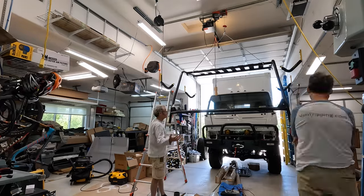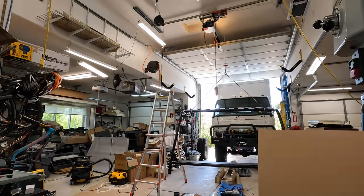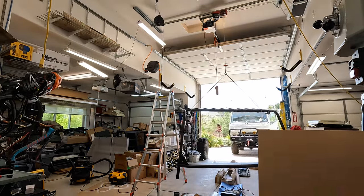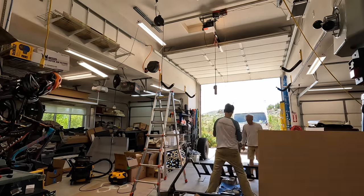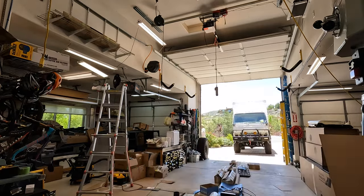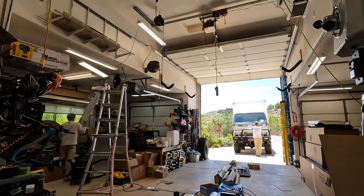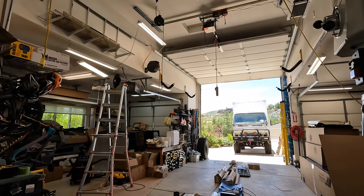That meant removing the roof rack, the front grill pieces and plastic parts that go over the front of the cab, and all the lights — turn signals, headlights, all those things as well. By removing these, I can get good access for sanding, and they don't have to be masked. Getting them out of the way saves a whole lot of time because it takes more time masking than it does painting.